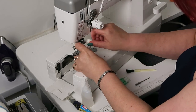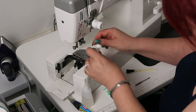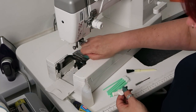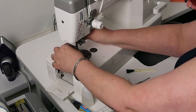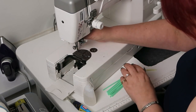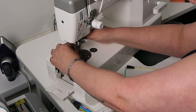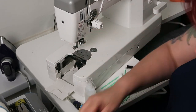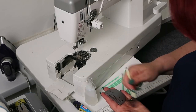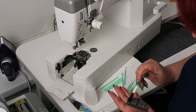I'm going to take off my needle plate as well. It's usually quite a good idea if you've got a spare little dish to place all the bits that you're taking off in a little dish - it keeps them all safe and secure and in the same place. I always just give the back of my needle plate a quick brush as well, and check for any damage.